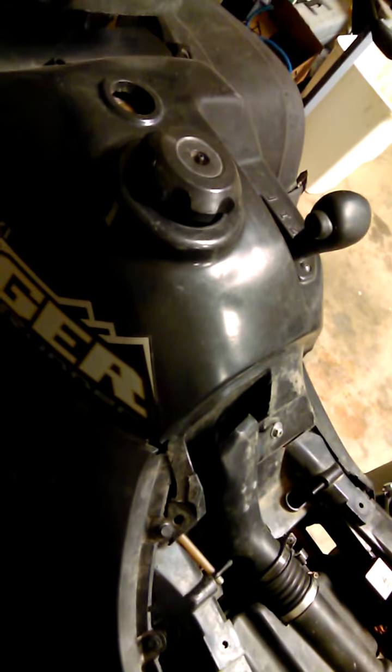So I went ahead and had them order me a stator for it, and they said it could be the CDI box, that the people I ordered it from probably gave me the wrong one. So I called Motorsport. They sent me the stator, and I put it in there, and this is what my four-wheeler is doing. And I cleaned the carburetor. Everything in the carburetor is working fine. It's not gummed up or anything like that. I checked the compression on there. It's fine.